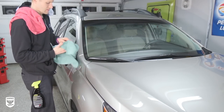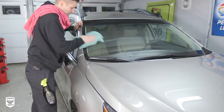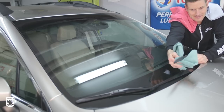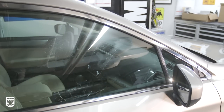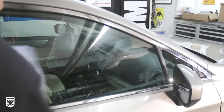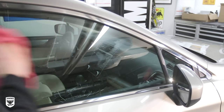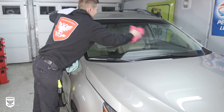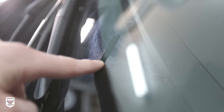While I'm waiting for the Reflex to cure after the buff-off, I focused on a deep cleaning of the glass using the three-towel method. The first towel is my throw-away towel, and I use it to pick up any heavy grease or junk stuck in the corners of the glass. Then I follow up with my waffle weave glass towel that I want to avoid getting contaminated after the first swipe — that's why that first towel is so important. Then I quickly follow up with a clean third microfiber towel to remove any possibility of streaking from the second towel. It takes a bit longer, but it certainly avoids the frustration of streaky windows on a perfectly flawless car.